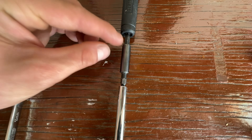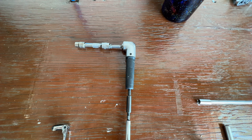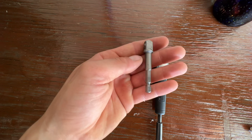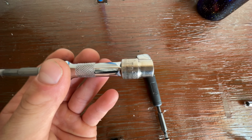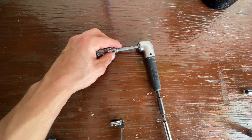This is the contraption that I made here — basically all the tools I used on those bolts. They're 10 millimeter bolt heads. I've got a swivel ratchet here. This will help you get up on the second bolt, the bolt in the middle. You can also try to get one of these in there with an extension with a 10 on it, or even a quarter inch one to give you a little more room because it's smaller after you get it broken loose.